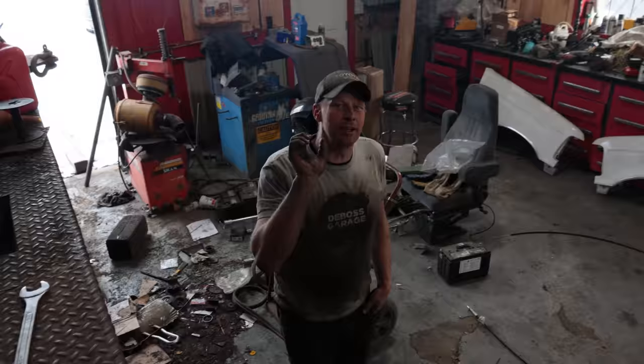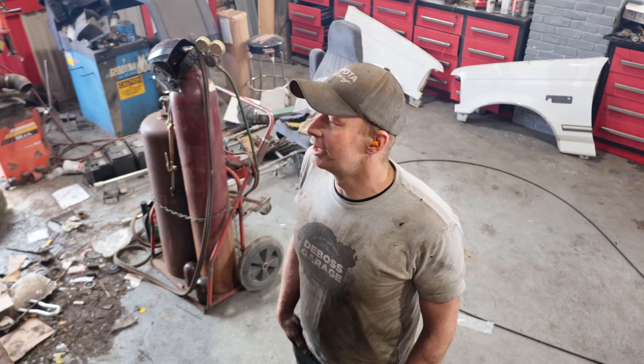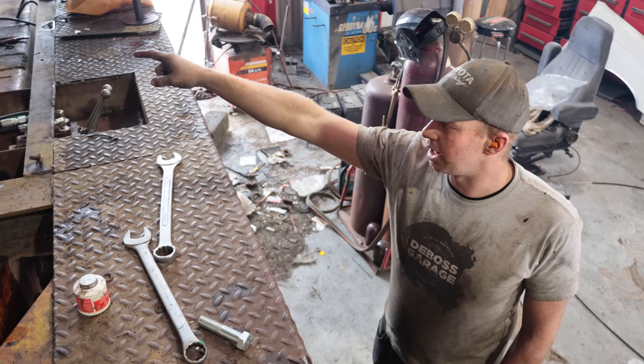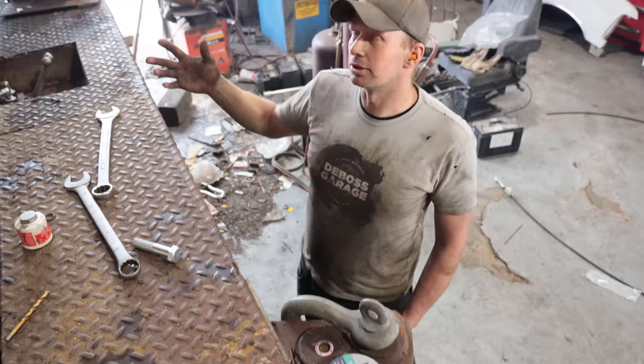Now all of a sudden it's super snappy, so something was going on governor wise or whatever. It needs a good run. But I got no oil coming out of the hose, so that means that pump is backwards. It shouldn't need a prime. I actually knocked that hose off and it spilled ATF all through my shop, so I know that hose is open. We'll flip that pump around in the next video.